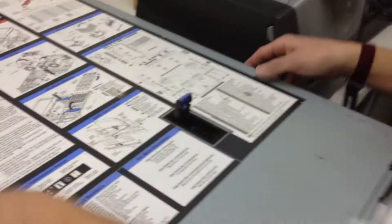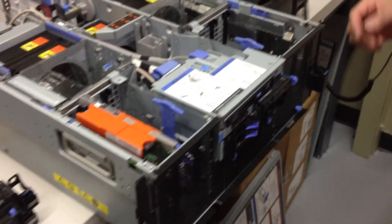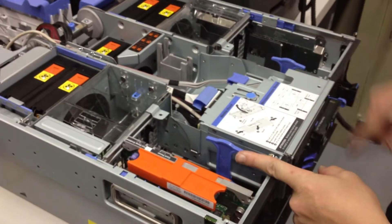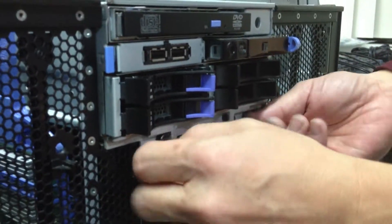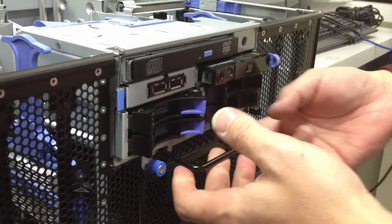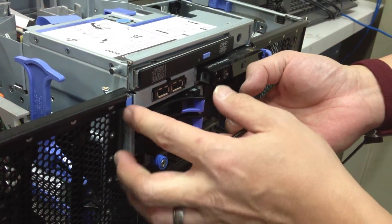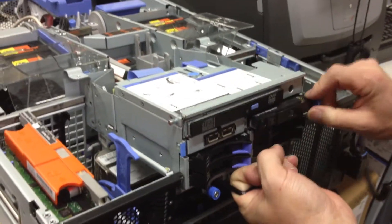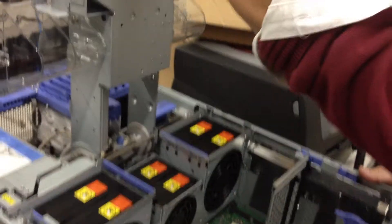Then the lid. This is going to be two CPUs only. Third and fourth CPU go in here, but you're just going to have two CPUs. You will likely have memory cards in all four of those slots. Undo these screws in the front here, then they give you a little latch to lift it with. Lift this straight up, push this tab in because it's going to bump against here — lift up, push in, and then up. This is very, very stiff; it takes a little strength and elbow grease to get it all the way up.